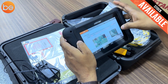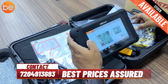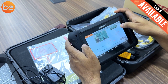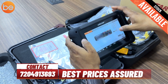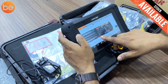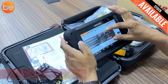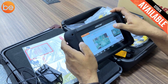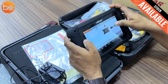They give clear information about all the pin connections and step-by-step locations as per the cable numbers. After finishing all the connections, you need to connect to the coupler as well. The coupler connections include 12V, ground, CAN low, CAN high, 12V, GPD0, GPD1, and 12V — same as KTM bench. These are all the connections needed for the internal hardware. As per the information, this boot mode and bench mode setup is good.